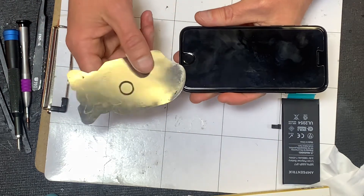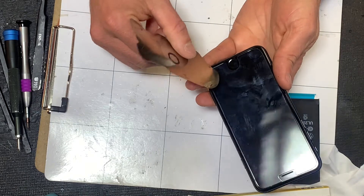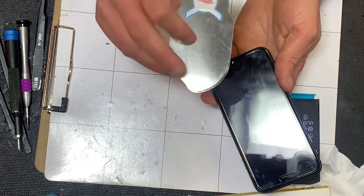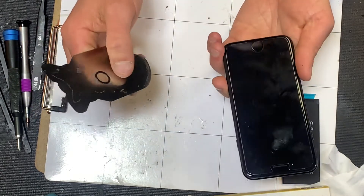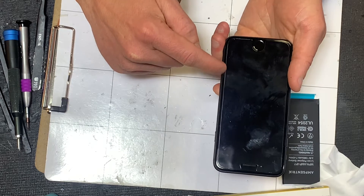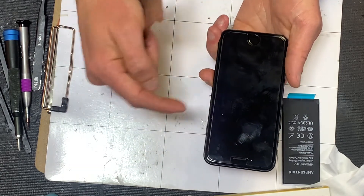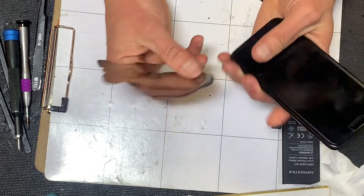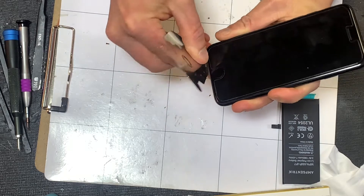We need to find an entry point. On different phones there are sensitive areas — on the iPhone 7, we have a sensitive area right here because the home button has a flex cable that goes right under there. If we get this metal card in too far we could damage that and brick the home button. The connectors for the screen and the digitizer — the part that senses your touch — are over here, and we don't want to get it too far. The motherboard is down here, the battery's right around here. We start here on the bottom left corner and fit the card right in.